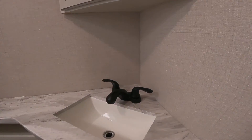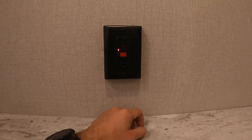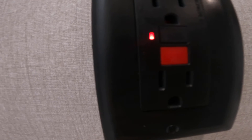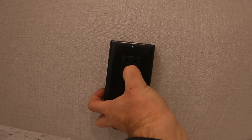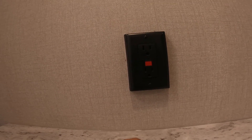Stepping into the bathroom, make note of your GFCI for the unit. If you see the red light on, that means it has tripped. You may also notice loss of functionality at various receptacles throughout the RV — most notably anything outside or near water. If that's the case, come in here, press the black button on top, the red light goes away, and anything on the load side of this receptacle will be functioning again.